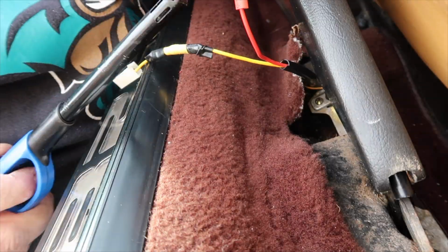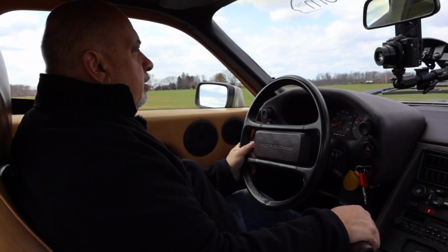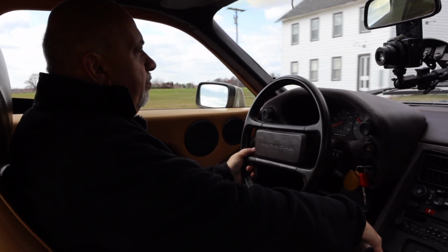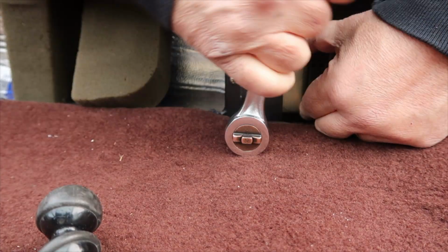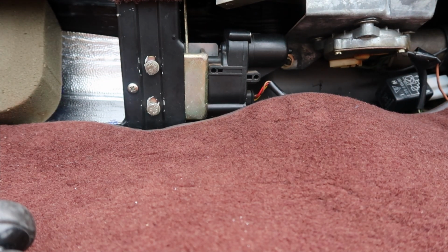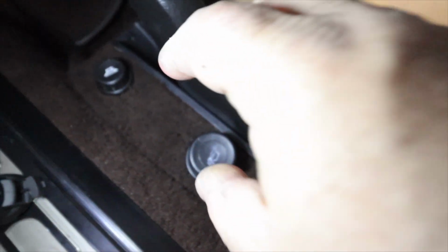So I had to resplice the wires, tape them all up well, get them all connected. And sure enough, once I put that all back together, I went back and I played with the adjustment, and it's counterintuitive, at least to me. But what I did was I actually moved the unit up closer to the lock. I thought moving it down would make the arm tighter and cycle, but actually moving it up forces the clip's hand a little bit with the articulating arm on the electric motor.